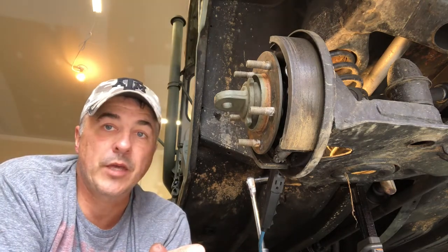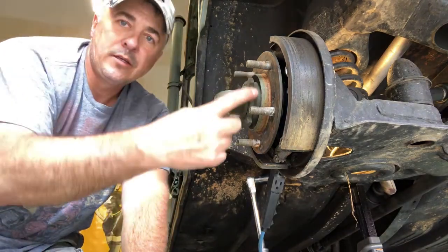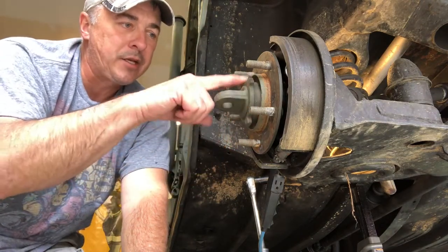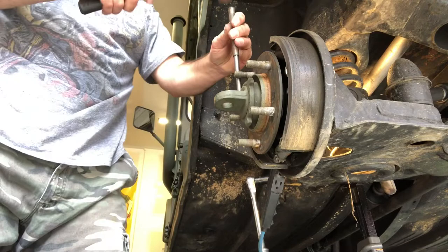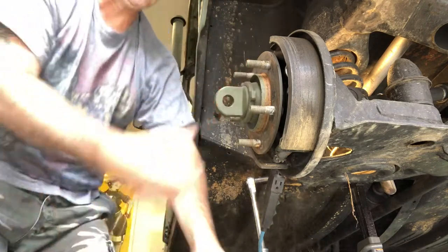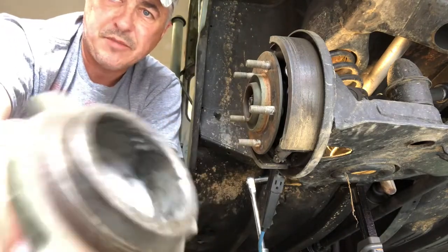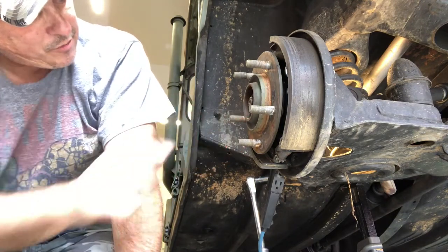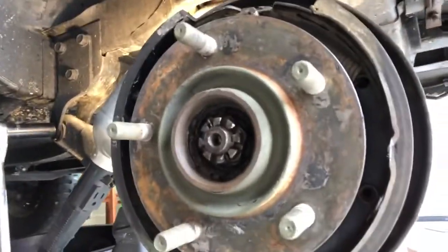Let's get to it. This is a lifting eye and you've got a lifting eye nut, which serves as a locking nut or a jam nut. I should just be able to tap this. Yep, it's loose - this really acts as a dust cap and keeps the grease inside the hub area. I can see right now the cotter pin is too small for this. We're going to get that cotter pin out and take out this castle nut.